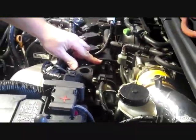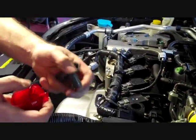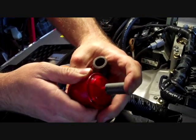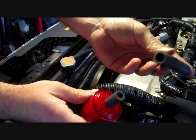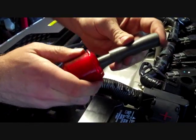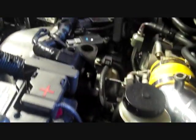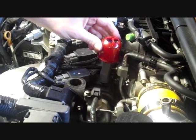For this application we actually have 15mm ports, so we have to use these hoses which are not provided — you can use any hose you like. First, get a small 10mm hose, put it on the breather filter, then get the larger 15mm hose and adapt it inside like so. That will allow you to connect it to the 15mm port.